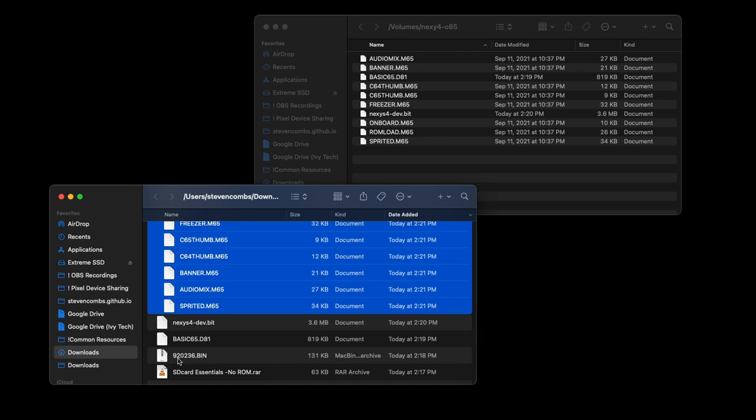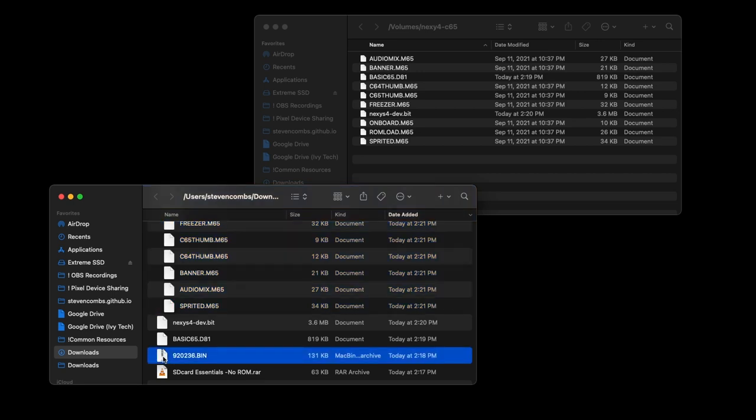The last thing we need is the ROM file. Now, the ROM file comes in this download right here with this information, which is the version of the ROM file, and then it comes as a bin file. So what we're going to do now is rename that MEGA65, and I want to get rid of the .bin and make that ROM and hit enter.